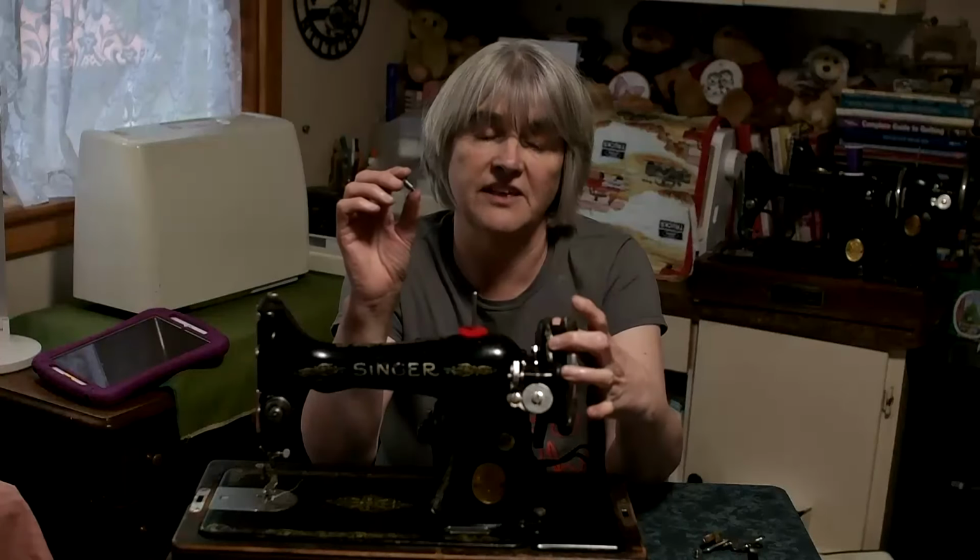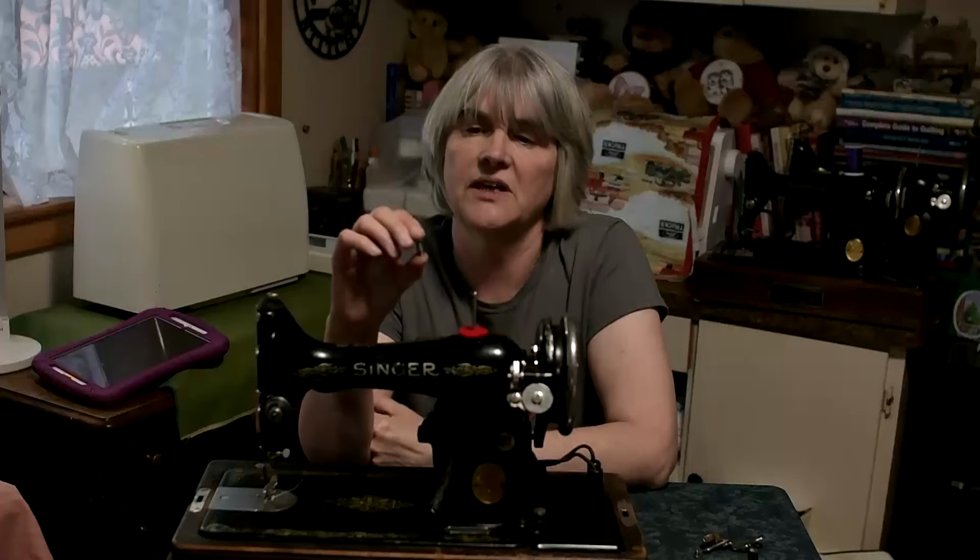I'm going to expand on that advice. Always use the bolts or the screws from the part they came out of. If I'd have remembered that little bit of advice when I came to fit this bobbin winder back together, it would have saved me a very, very large amount of hassle. I tried to use the parts from this mount on the shiny one, only this bolt here wouldn't fit. It's just a little smidge too thick, and what I ended up doing is using the parts that are on the original winder and just swapping out the spring, which is exactly what I should have done in the first place.